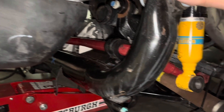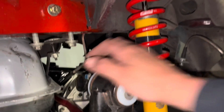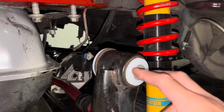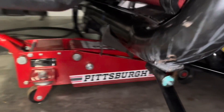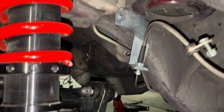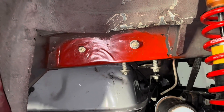The shell is this lip right here — that's where the rubber bushing slides in, and the Delrin bushing will go in there. I did every single bushing on it. He got the whole kit — the most expensive kit with all the tools — and I think it's worth it, because you can't put a price on not spending hours on one bushing. It took me no more than three minutes or so to pop it out with the correct tool. It also has new hubs with the extended studs. I'm going to pop it back in place and weld on the subframe connector still.